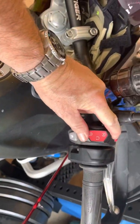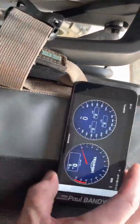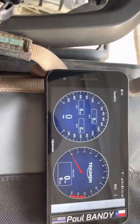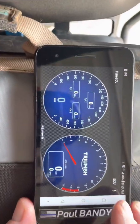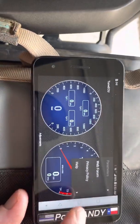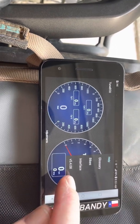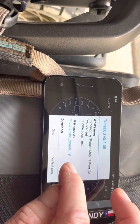Then you can go back to your bike, plug your dongle in, turn your bike on, make sure to set the switch to run. I'm going to open the app here to show you guys where to go. Once you get back to this screen when you first plug in your bike, we'll turn this on, set to run, and it's going to connect our dongle. Hit the three dots, go to help — this should show your version. If you click on that, you can actually get to the website I was talking about to register your email right there.